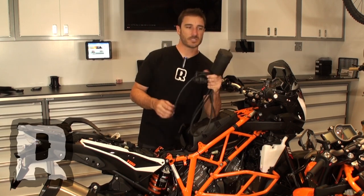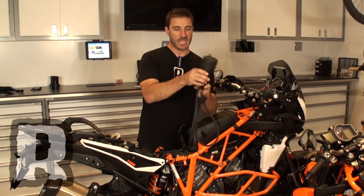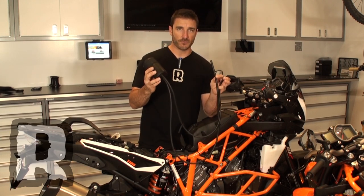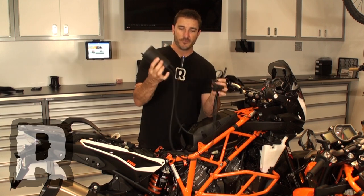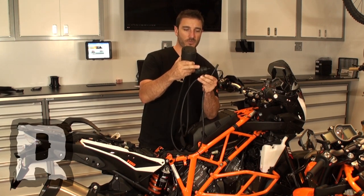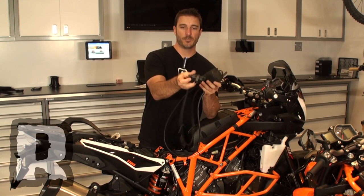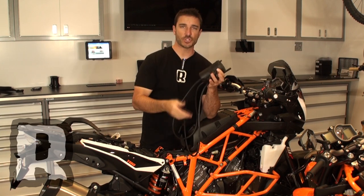This is the canister system, and the SAS and the canister are often mistaken for the same thing. They're actually two different things — they're just typically done at the same time. What the canister does is it basically pulls the evaporations from the fuel tank. The fuel tanks don't vent to atmosphere; they vent to this can. This is a charcoal can, and from the back of this charcoal can there's another line that goes to this little valve here, which is very similar to the SAS valve — it just opens and closes with 12 volts. When you start the engine, this valve opens and the throttle bodies basically pull a vacuum on this and it consumes the emissions.